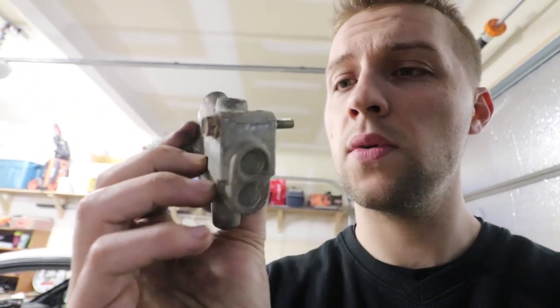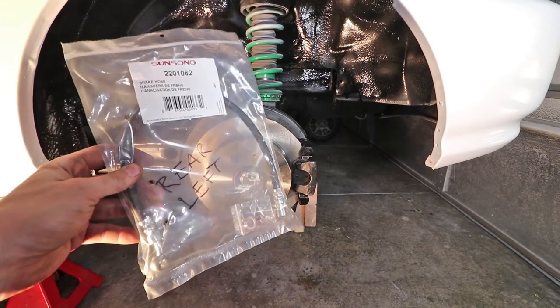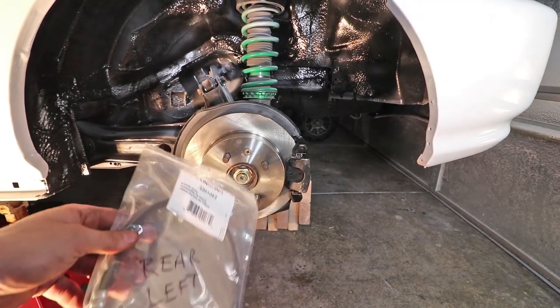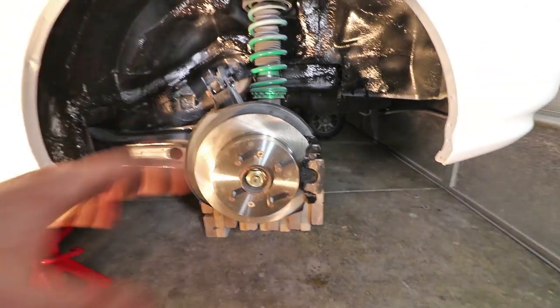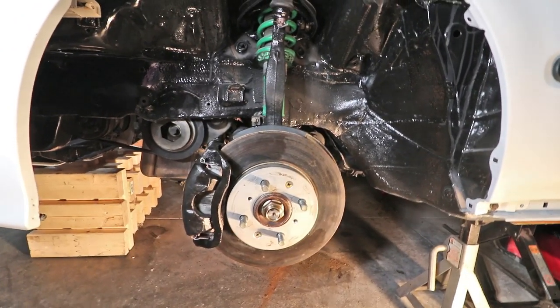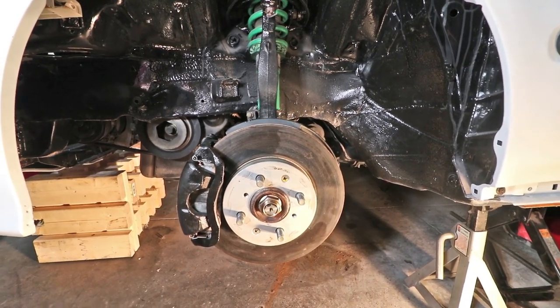I have to go to the junkyard tomorrow and pick up a new proportioning valve for my brake lines. The mounting point right there on the very back end is cracked in there so I have to replace that, so I'll pick one tomorrow and I can start working on making these custom brake lines. I also have my hydraulic hoses, which I picked up some brand new ones here. I'll link these up in the description. I needed these for the conversion that I have so they fit properly. From that the rear brakes are done as well as the front brakes. There's a lot of videos online that do a lot more detail on replacing brake pads and everything. I just quickly threw these together on the fronts and the rears.